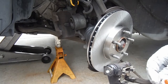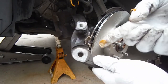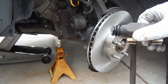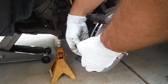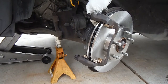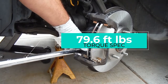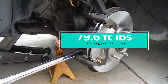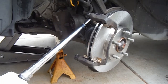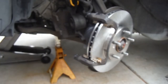I'm also going to put a little bit of Silglide in the little notch on the bracket before putting it back on — it's easier that way. Then the caliper bracket goes back on. The torque spec on the caliper bracket bolts is 79.6 foot-pounds — definitely not 80, that would be way too tight — just kidding. The torque wrench I'm using is a Gear Wrench 85062 — it's a nice wrench. Be careful not to get any grease on the rotor face.